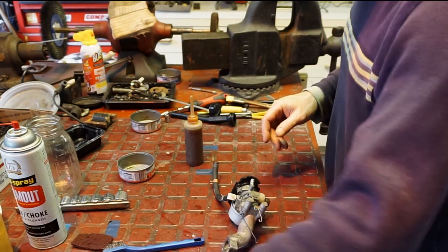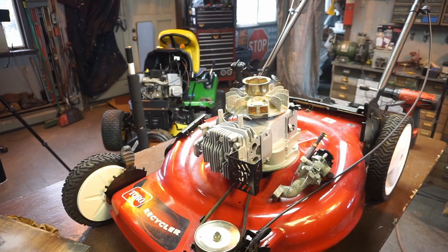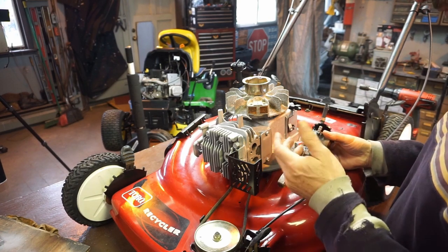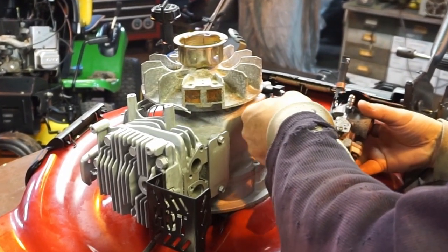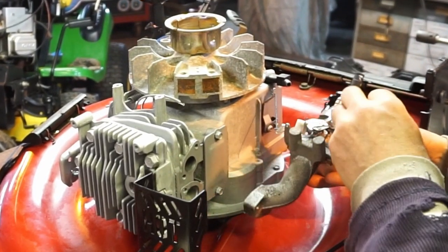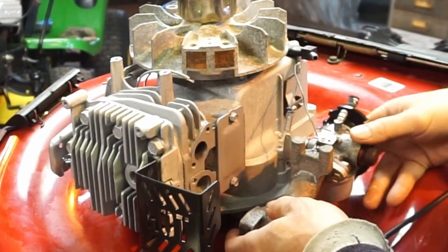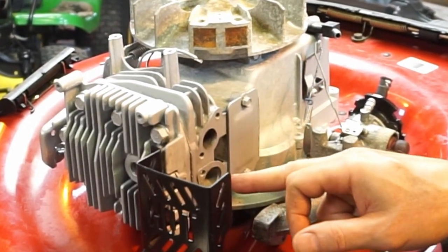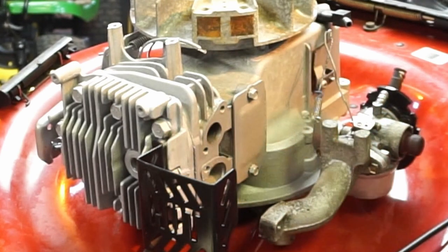Let's put our clamp on and go over to the other table and install it. All right, let's pop this on. The piece with the spring goes on the bottom, and the throttle goes on the top. Now in this case the gasket was good, but when I sprayed with the silver I coated it heavy in here because that actually helps seal gaskets — engine paint does. We even used to use high-temp engine paint on copper steel shim gaskets for Chevy 350s and high-performance engines. I'll put a little bit of anti-seize on the threads.